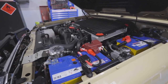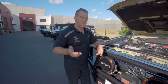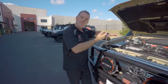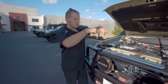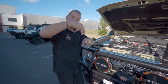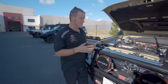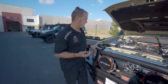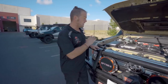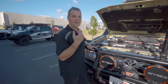And you might not be the first car, but you are probably the third or fourth or something like that. There's already a lot of debris in the water, leaves, mud. All of that is being sucked through the alternator by the fan blade in front of it, and eventually it gets to the brushes, and the brushes get stuck, they don't move anymore, and they lose contact with the rotor, and your alternator stops charging. It's still perfectly fine, all you have to do is take it apart and clean it, but not everybody knows how to do that. Brushless alternators don't have the brushes, so they can't get stuck, so you get rid of that fault, which is almost every alternator failure that happens out in the bush.